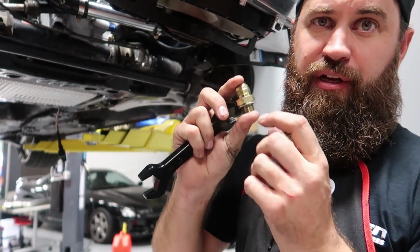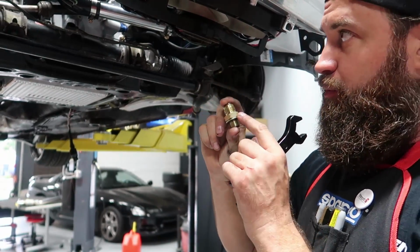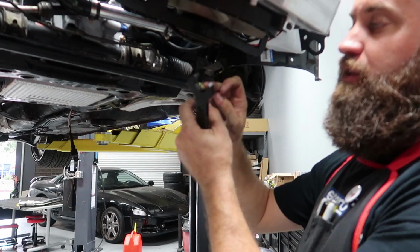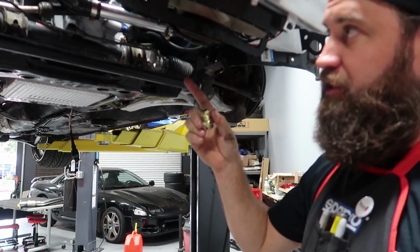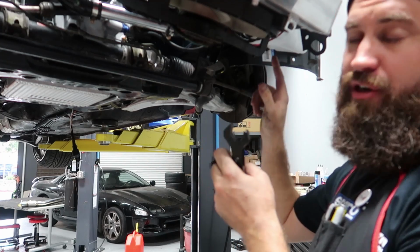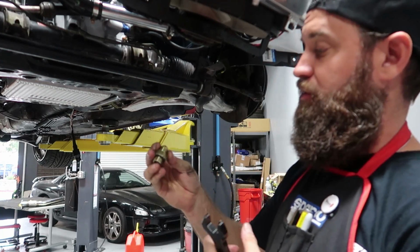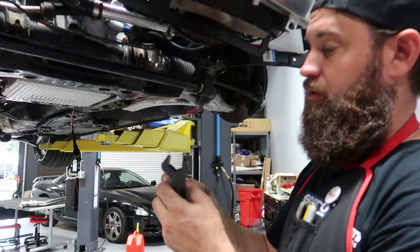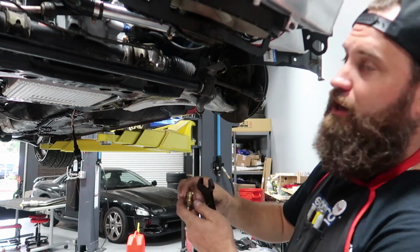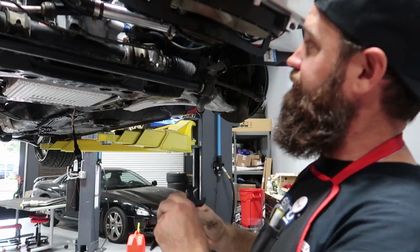All right, I'm going to go ahead and put the low pressure side of the power steering equation in place. This is a fitting that takes it from the rack to a dash 8, and we're going to run dash 8 to our cooler. And on the other side of the cooler, it's going to return back up to the reservoir for the power steering pump. This is a trick setup. This is exactly what we did on TJ's car. Unfortunately, none of it was documented, so now we're doing it.